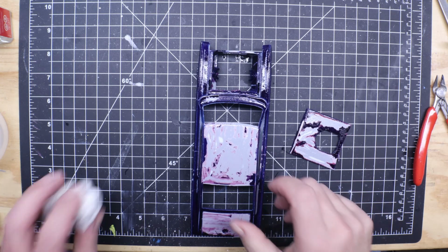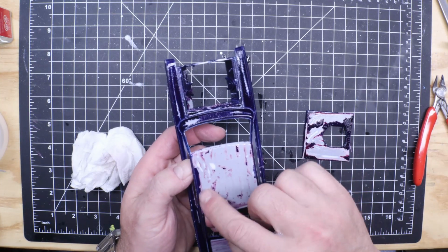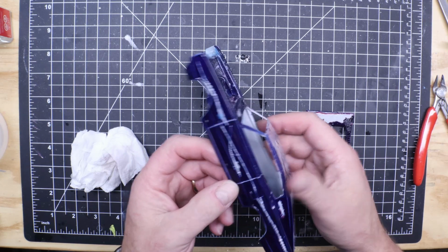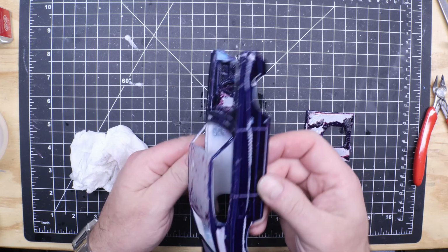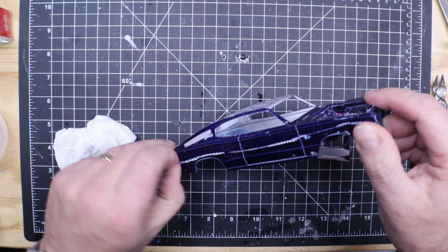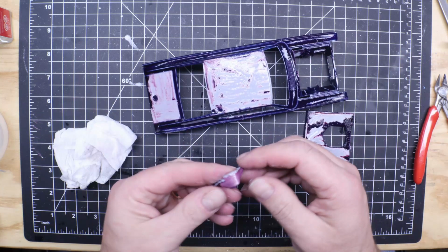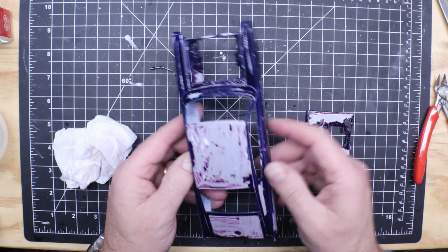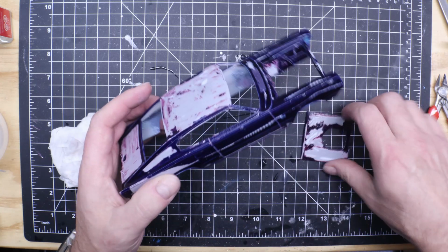Okay, now back from the sink, and I believe what I've discovered here is this is the gray look. That's Createx, the silver sealer. So thinking that the 2K is pretty much been eaten up by the brake fluid, and I believe what I'm seeing now is waterborne paint, Createx. See, this is coming off. Some of it's peeling off, and some of it's bound on there really good. And so I'm guessing the brake fluid is having no effect on the acrylic paint. Though, of course, it's an acrylic urethane once you add 40/50 or 40/30 in it. So I think that's what we have here too.